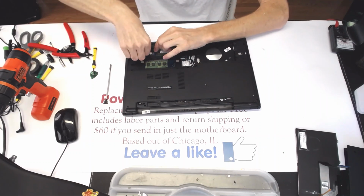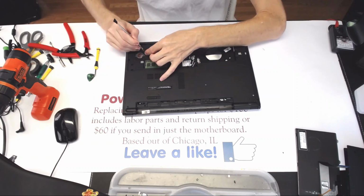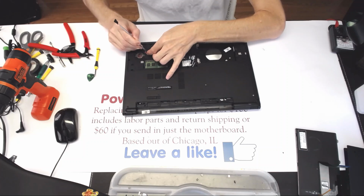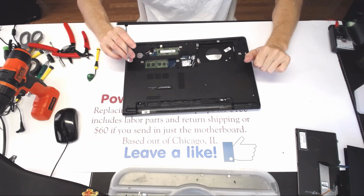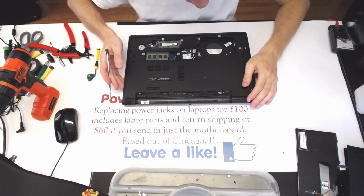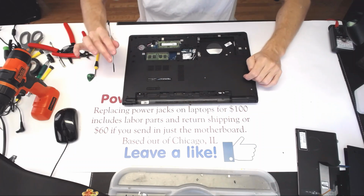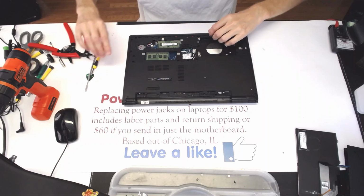So here we connect the speakers. Like that. By the way, I didn't disconnect the video cable when I was replacing the jack, even though you could. It's just that sometimes the more cables you disconnect, the more chances the hinges or connectors are gonna go bad. So I just try not to disconnect what doesn't need to be disconnected.